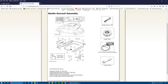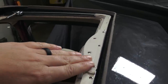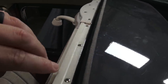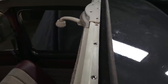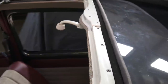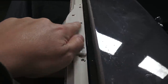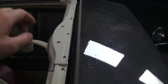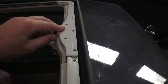In the beginning, nothing really fit right. You have to understand when you put these plastic pieces on, they are not meant to be muscled down. The screws they give you will strip, so just tighten them down till snug and use a small screwdriver or set your electric screwdriver on a low setting. We also noticed that the cover piece where the cables feed through — the more we tightened it down, the more difficult it was to move, and the cables were binding and clacking. So we had to back off to relieve tension.